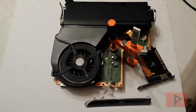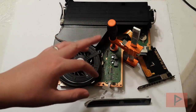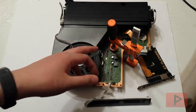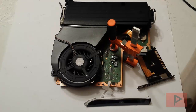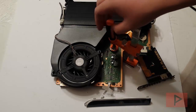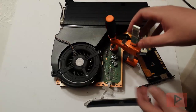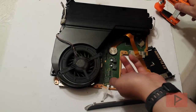One thing you'll notice is it's very important to have a clamp system to secure your E3 Flasher clip to your motherboard. This just happened to be a motherboard where the NOR chip is right here in this location. So when you apply your clip, you want to make sure you have enough even pressure across both sides of the contacts — the left-hand side and the right-hand side. One easy way to ensure that even pressure is to put a coin on top of the E3 Flasher clip.